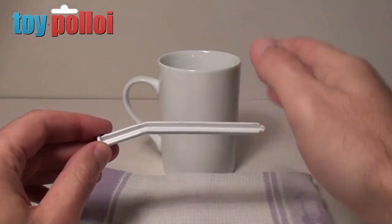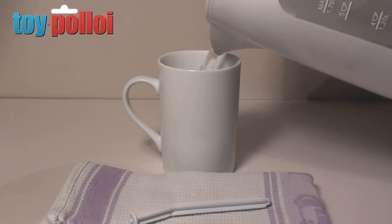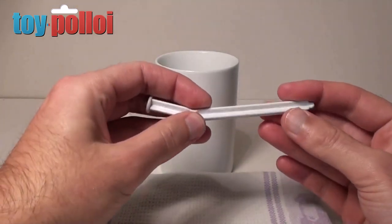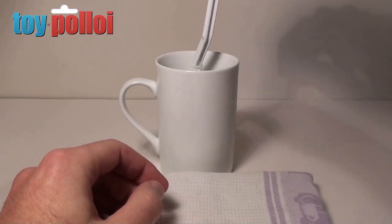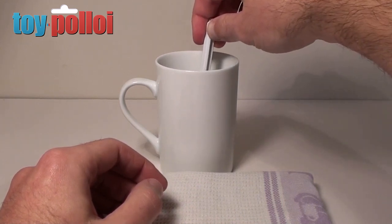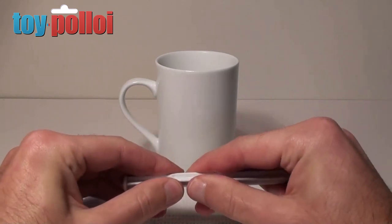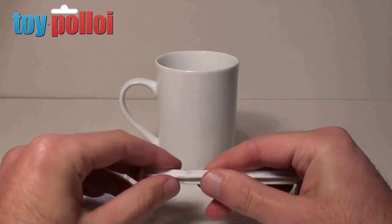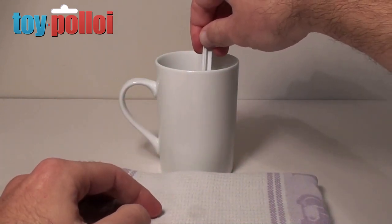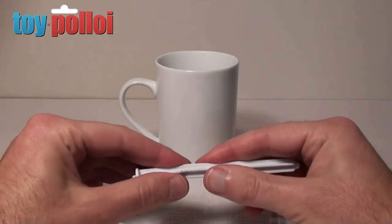So to bend this back what I've got here is a mug and a tea towel and I'm going to fill the mug with some freshly boiled water. If you're going to do this do be careful — this is hot water. What you've got to do is dunk this bit of plastic in the water just for a short amount of time. You don't want to dunk it in for too long because you can damage the plastic. You just want it long enough that the plastic starts to soften. Quickly dab it on the tea towel so you're not getting covered in boiling water, and you can then gently start to bend this back to the correct shape. Do this slowly — don't do it all in one go, just do it little bits at a time. As you can see that's already starting to get straight again, so dunk it back in the boiling water. Again wipe off the water on the tea towel and start to bend it back.